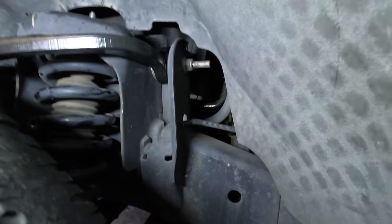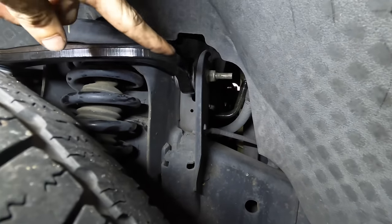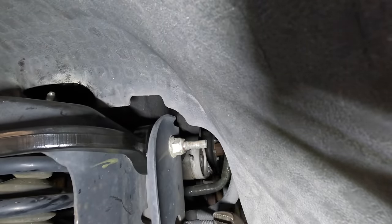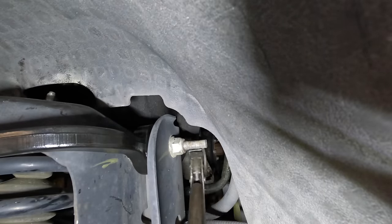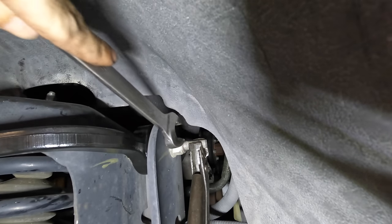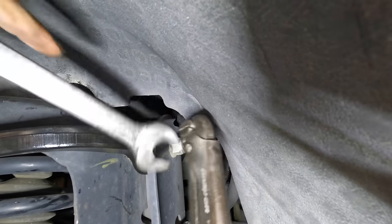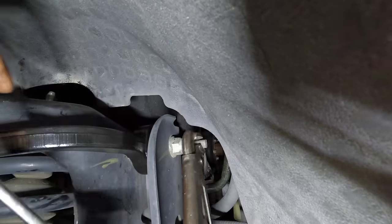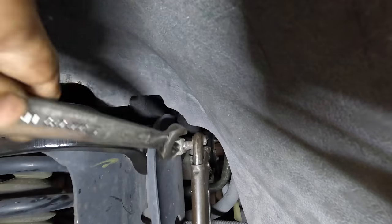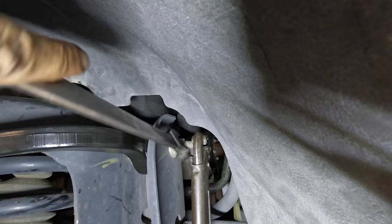The truck's up on the rack. First things first, let's go ahead and tighten down the upper control arms because there will be no adjustment made with these uppers. Now the lowers, on the other hand, I think they do have some slots and are somewhat adjustable, so we're going to have to wait to fully secure those when the alignment measurements are made. I'm trying to cheat here — I don't want to reach a wrench in behind here, so I'm trying to do it from the right. Yeah, that'll work — kind of a tight squeeze, but I can pull it off.